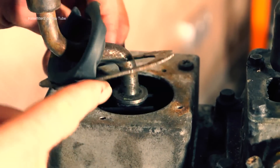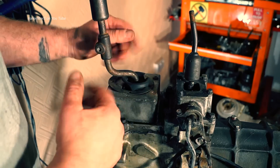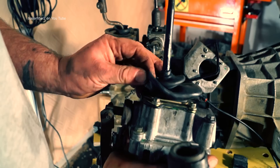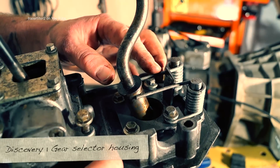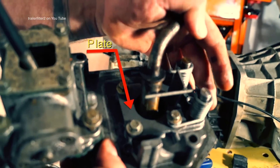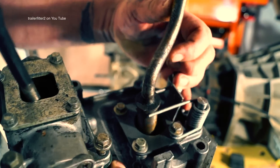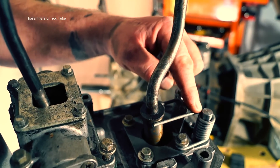The main H-box — as some people call it — has a missing seal and springs inside. Both levers should have rubber boots on to give a good seal. Inside the H-box selector you have a plate and springs. If that plate is broken you're going to have a sloppy gear stick. These springs are very important — they're what give you the resistance on your gear stick.